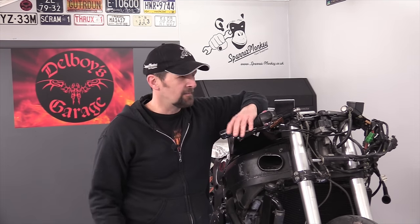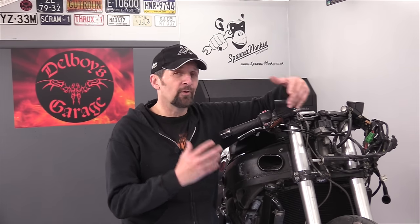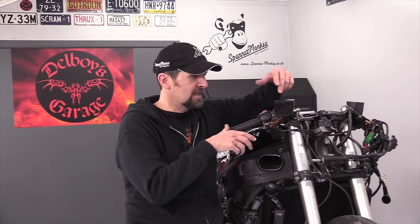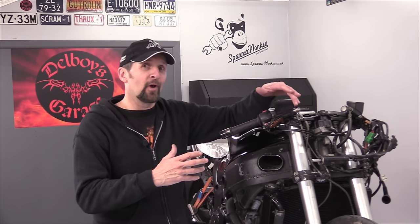There we are — a nice solid braking system. This video wasn't about bleeding brakes, as I've got lots of videos on that. This was about passing on the trick of priming up a dry system. We constantly get messages from people who've fitted new bone-dry brake hoses and just can't get them bled. There are a few methods: you can take a syringe and inject fluid up from the bottom to get enough in to prime it, or buy tools to do the job. But this method needs nothing — just prime it using gravity and a little siphoning action. Drop the hoses off the bottom, tickle the lever, and it just drizzles through.